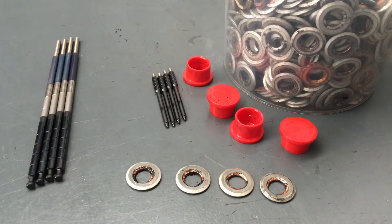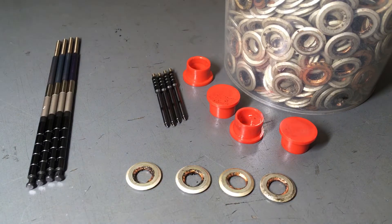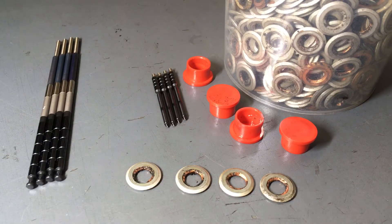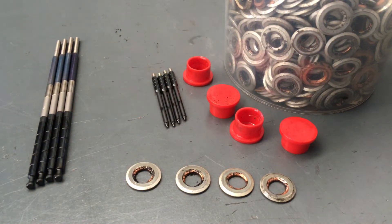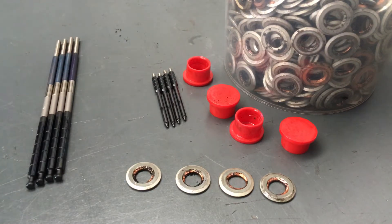The nozzle needles — that's what's wearing on these. I'll shine a bit of light on them so you can see. Those four nozzle needles all four of them have got wear on the little tips. That's what we're seeing. Everything else is awesome — the DLC coating and that section look great — but it looks like the nozzle needle tips are what's going to wear.